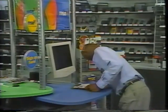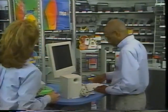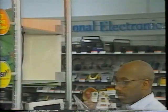To install the speakers, you need to remove one of the graphic panels. Two of the panels can't be removed. You can only remove the panel that isn't held to the shelf with L brackets and screws. Push up on one of the brackets holding that panel and gently flex outward.